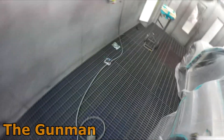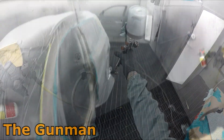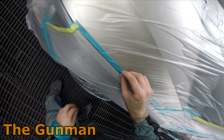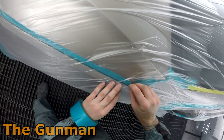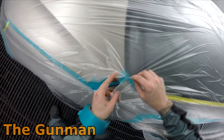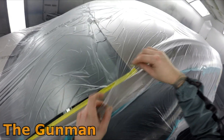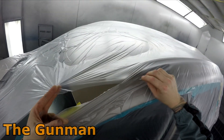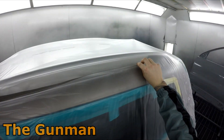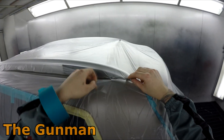You may notice I didn't even sand the inside of that panel. This is something that's taken me a while to get my head around, but I've been told now by so many paint reps that their wet-on-wet is guaranteed to stick to unsanded E-Coat. E-Coat is that black primer you see on just about any brand new panel - sometimes it's grey. They do actually guarantee that, so you can not even sand the exterior of a panel, put the wet-on-wet down, and that will guarantee adhesion.